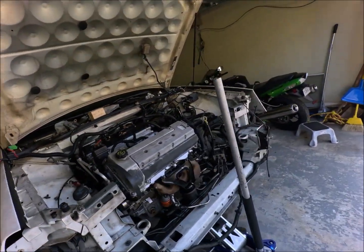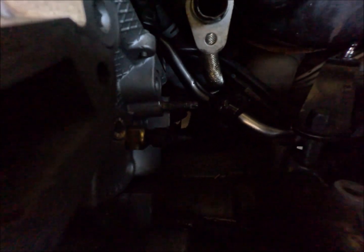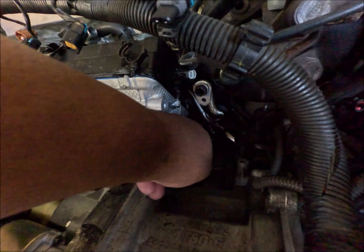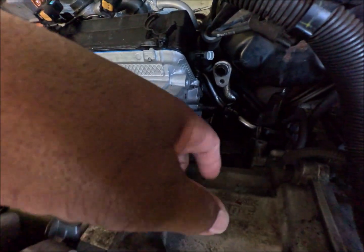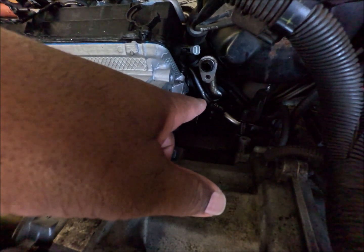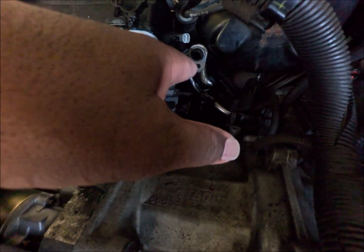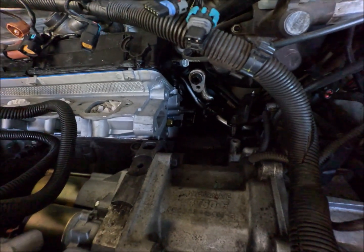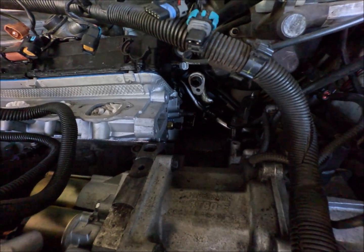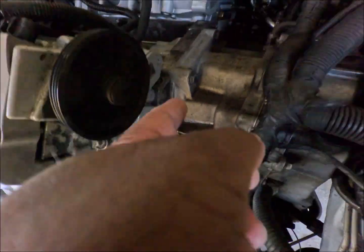All of this is on the side right between the motor and transmission, but there's another bracket on the other side, right there. I just took the bolts off of it. If you take a big screwdriver, try not to break your temp sensor — you can push it over. There might be one single bolt near the back of the transmission you might be loosening. I've never loosened it before; I just pushed the bracket over and pushed it back when reassembling.